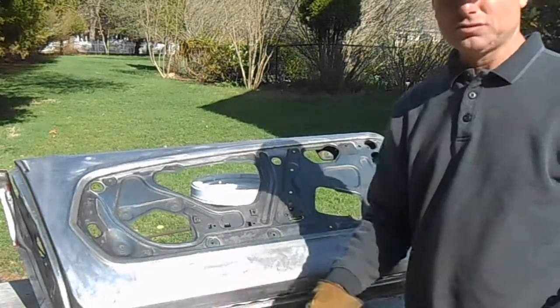I just like to make sure there's never any question in my mind what goes where. I'll put this down in the workroom and eventually clean it all up and lubricate everything. On the passenger side one there's a spring in here — you can get a replacement spring if yours is really rusted out. This one doesn't look too bad. Everything works pretty smooth, and once we clean it up, degrease it, and put some fresh grease on it, it'll be just like brand new.